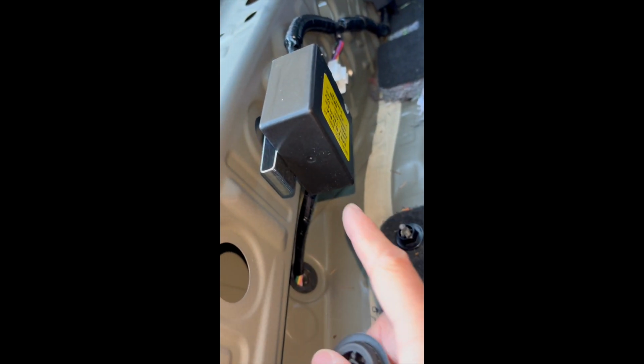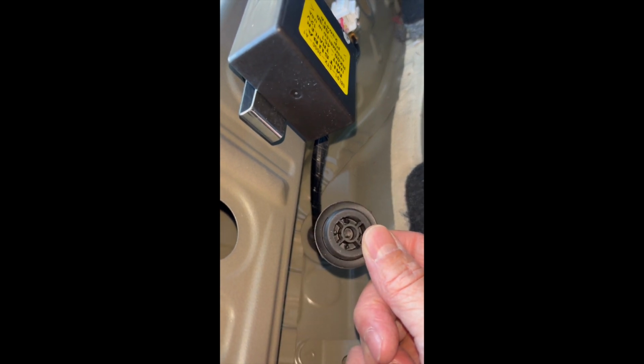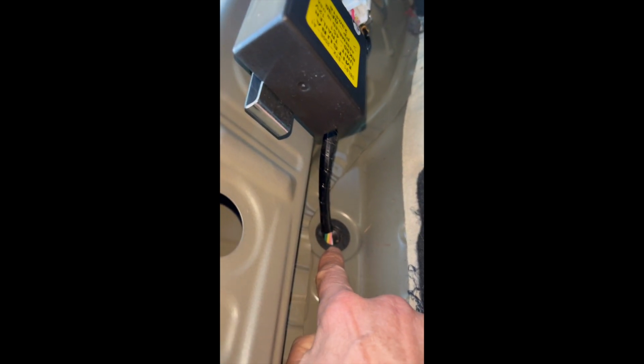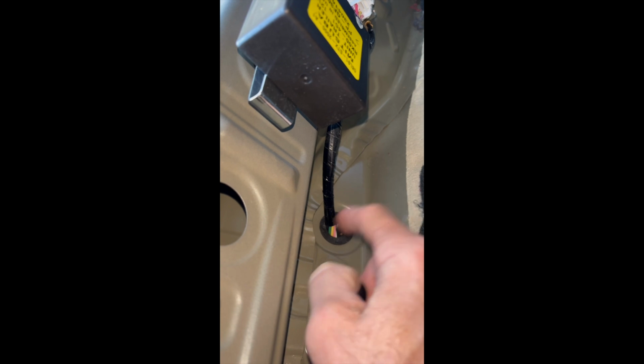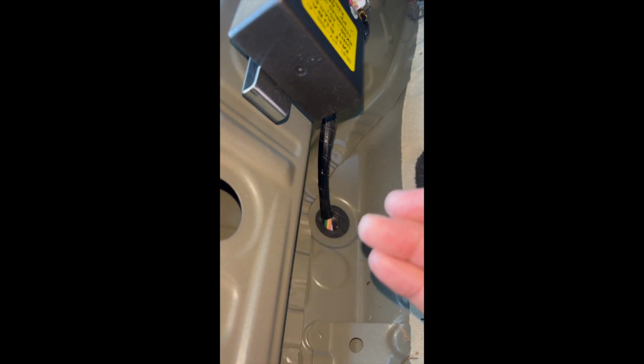Okay, with the hitch installed, before you install the bracket and harness B, go ahead and lean up here, go back in under the unit that you connected. This is where you're going to come up underneath the car, but you're going to see this grommet is going to be in this spot right here. Just push it and it'll pop right out, and then you'll have this grommet removed so that you can feed these wires through once you go back down to connect the other harness.